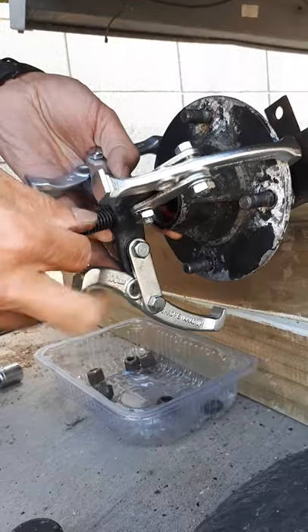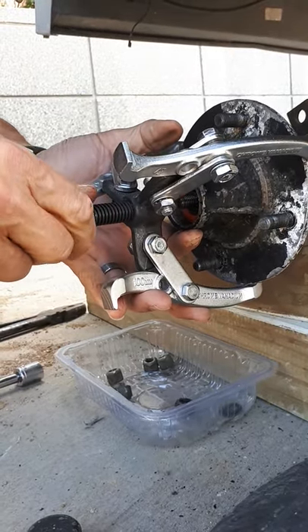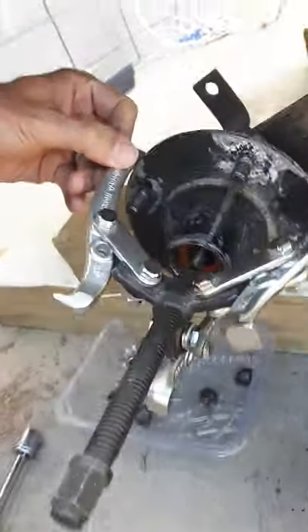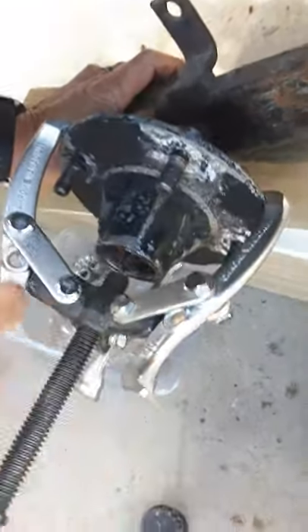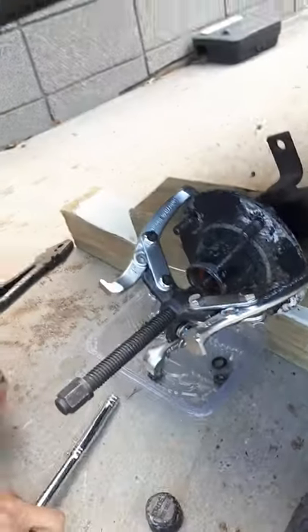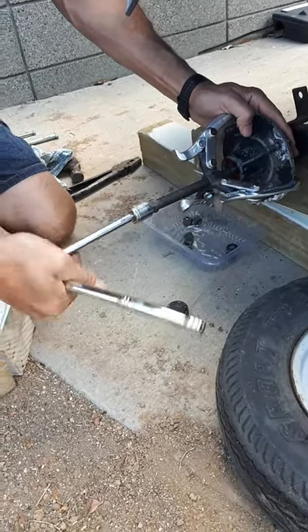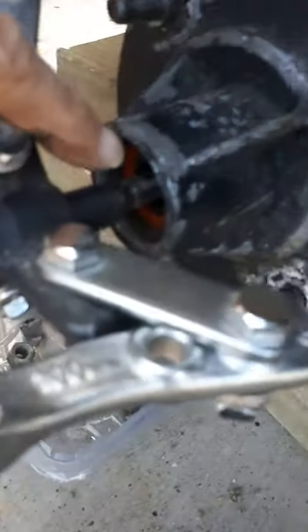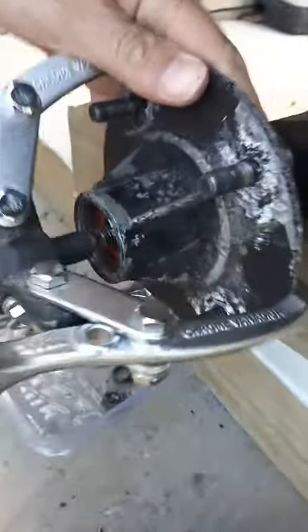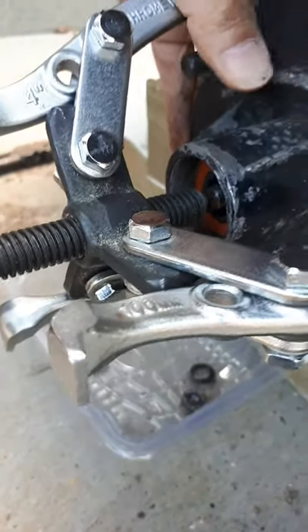It's a little fiddly to set up but we'll get there. You've got the tripod going in three different directions, with the central winch of the tripod right onto the axle itself. When I crank on this it will pull the whole hub off evenly and it should just pop off. You can see it coming out — the orange thing in there is actually the bearing, it's a sealed bearing. As I pull, you can see the entire hub coming off now, and it's coming off quite easily. Previously I was beating the heck out of it with the hammer and it just didn't come off.